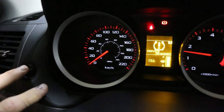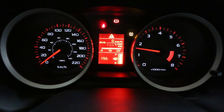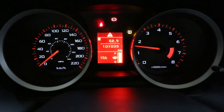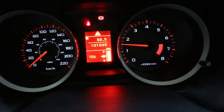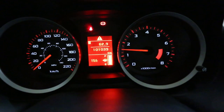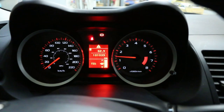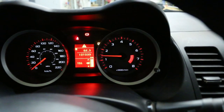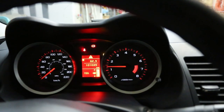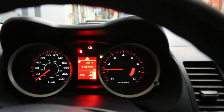We've got the tire pressure warning 'service required,' which never goes away on these cars. You have to press and hold the info button until it goes away and you get your regular menu. However, if you notice on the top there's a red exclamation point triangle — that means it has a timing chain warning on the service manual.